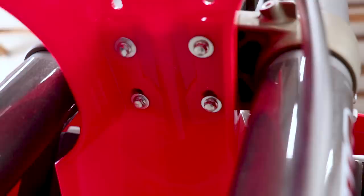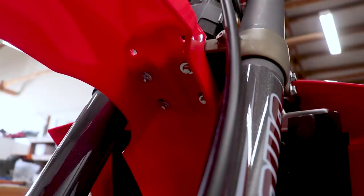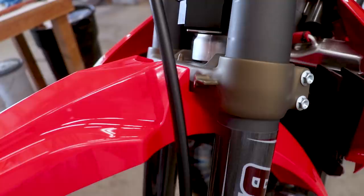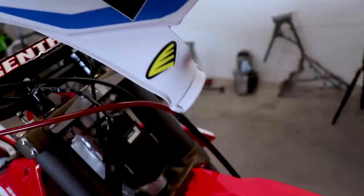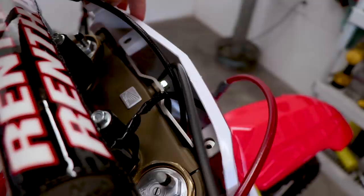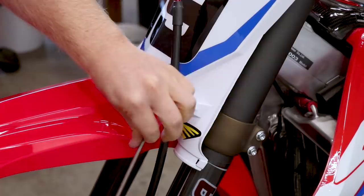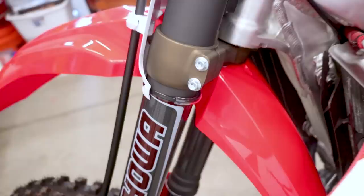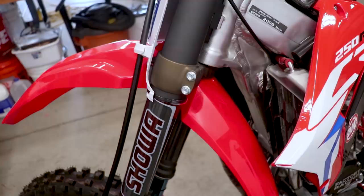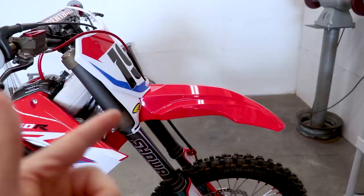It's a bummer there's not a cleaner way of mounting this honestly, but I've run the same setup on my 125 for a couple years and you probably never would have guessed it — works great, never had any issues. The reason we couldn't use the existing holes is because the fender sits too close to the triple clamp where the step is. The reason for the tubing over the zip tie is so the zip tie doesn't wear into the coating on the fork — that actually happened on my 125, so I'm being proactive this time. The front end is all mounted nice and solid, just like OEM.